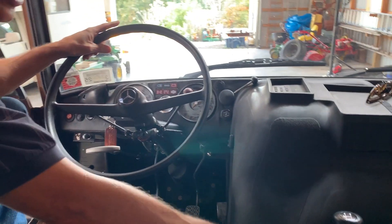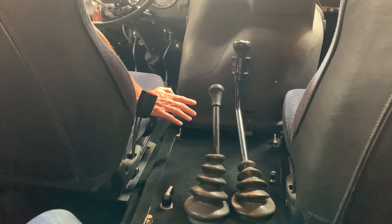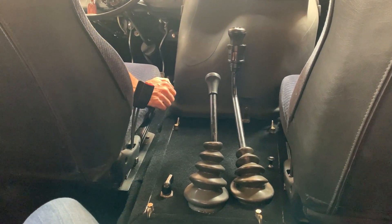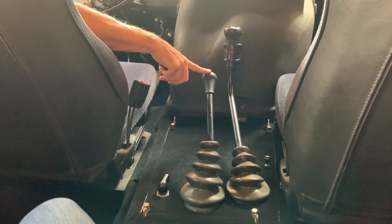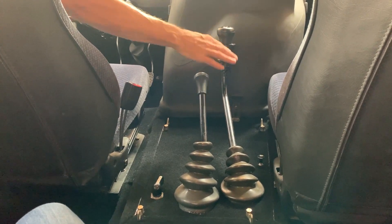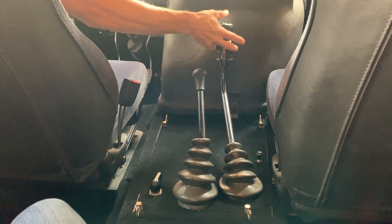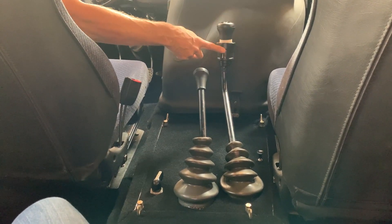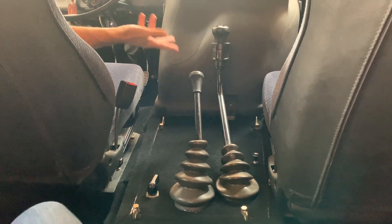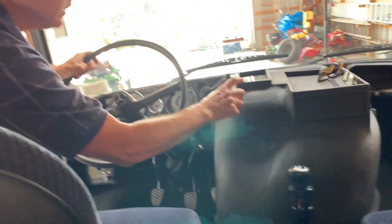The 16-speed transmission is nice because in a 20-speed Unimog you can have five shift levers, or seven if you have both PTOs. With this one you only get two shift levers. One is high, low, reverse, and the other is a basic four-speed H-pattern with an air-activated underdrive. You step on the clutch, push it down, hear it click, let out the clutch, and you've lowered your gear ratio 22 percent. Pull up and you're back into high range out of the underdrive.